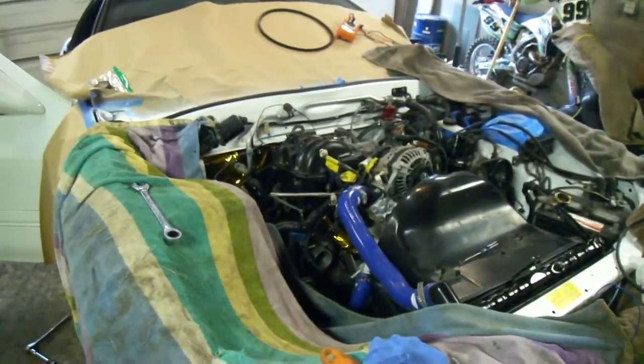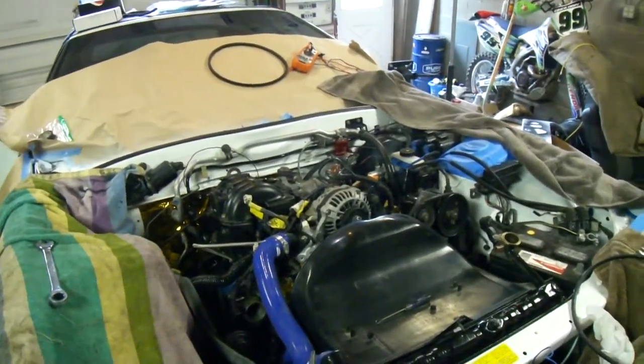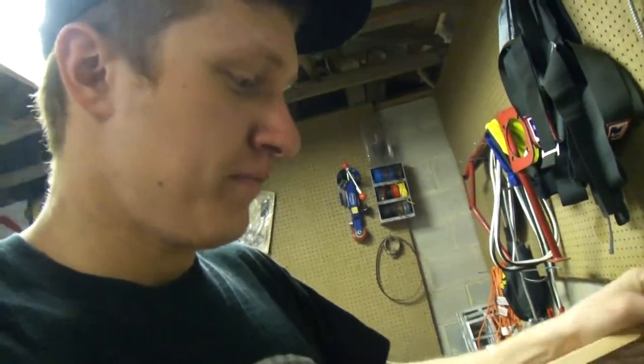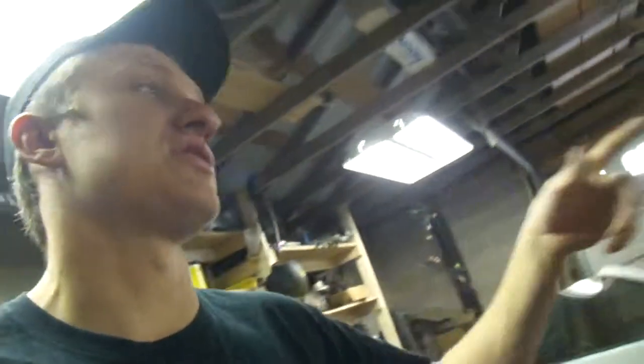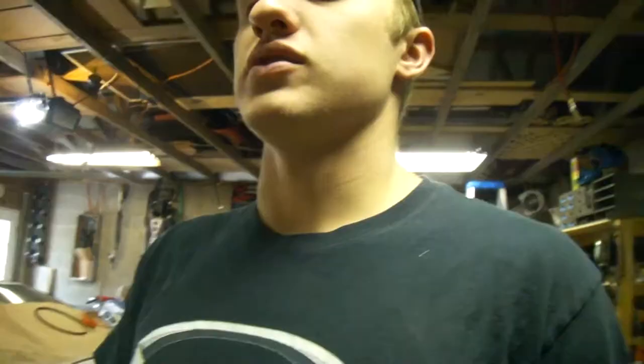Once the engine stuff gets sorted, I'm waiting on piping to come in for the intercooler and also my heat exchanger. If you recall, I said I'm running a water-to-air setup. So I ordered a dirt bike radiator - basically a replacement radiator for a Honda CRF150R - so it's basically going to look just like one of these. It'll look similar to that but with no caps or anything. I also ordered a coolant overflow reservoir that's about a liter and a half.